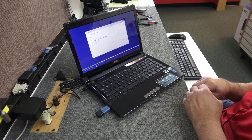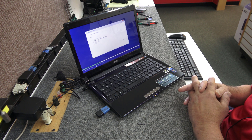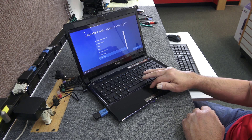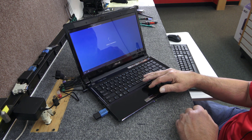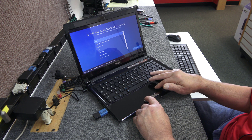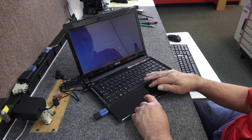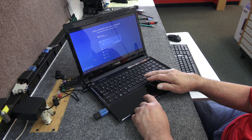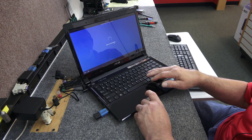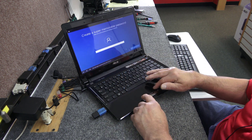I'm going to let this go — I'm not going to bore you with the whole process. When it's almost in Windows I'll come back and we'll see if we can activate Windows using the product key. All right, just about there — going through the quick setup for Windows 10. I'm not going to connect to the internet right now, I'll plug in the ethernet later. I'm doing this so we don't have to set up a Microsoft account during this process. No password.